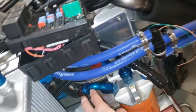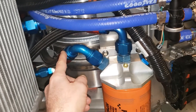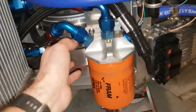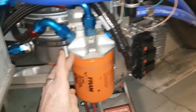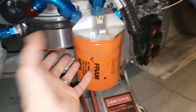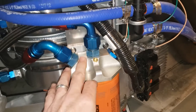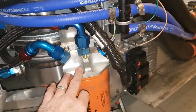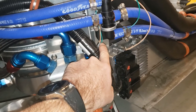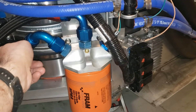I totally forgot about the oil filter. The filter comes directly after the pressure section of the pump, before the thermostat. This is a Fram HP6 — it's a huge filter, and bigger's always better, right? Since you're doing a remote filter anyway, I just mounted it up on the bracket over here. I've got a temperature sensor over here that wires into the dash, and then out into the thermostat.